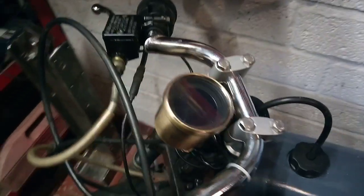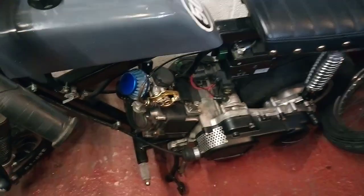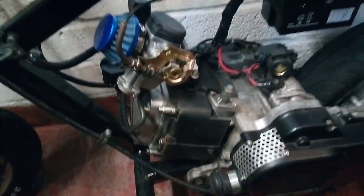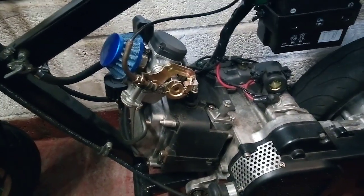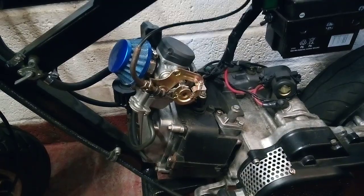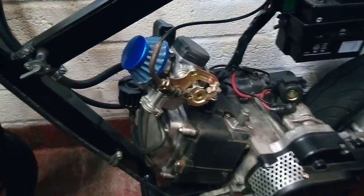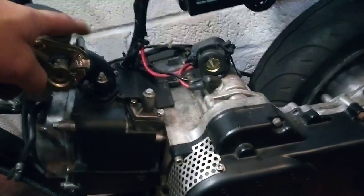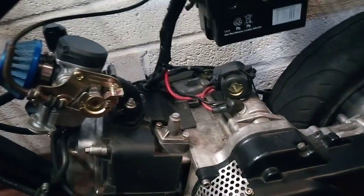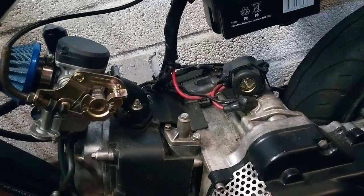The biggest change — what's missing? No boost gauge. The reason for that is no supercharger. There were some comments about using a different carb, because these CV carbs aren't that great — I tend to agree with that. There was also a vacuum leak issue; the clamp was basically opening up, and once you tried to tighten it, it would slacken off. So I think that's where the vacuum leak was.